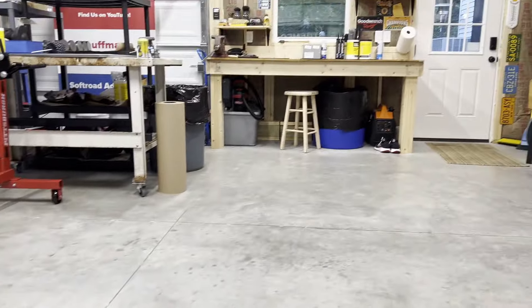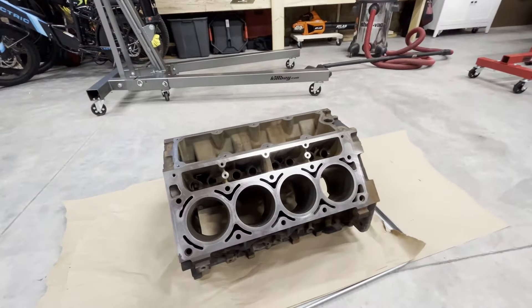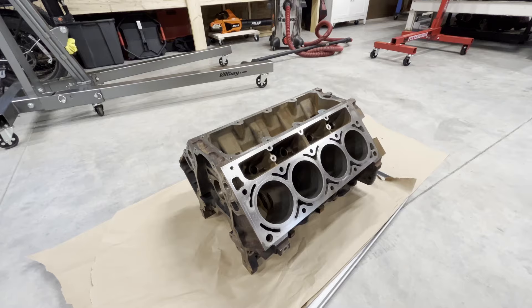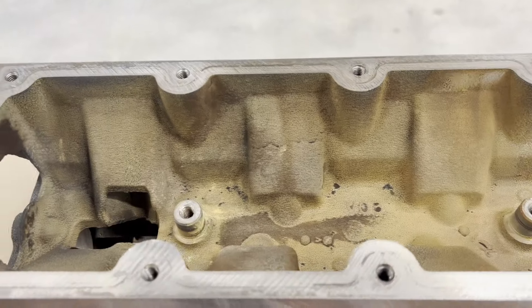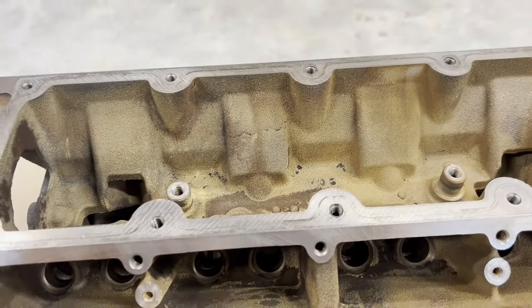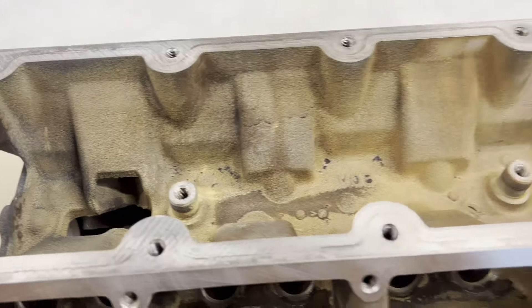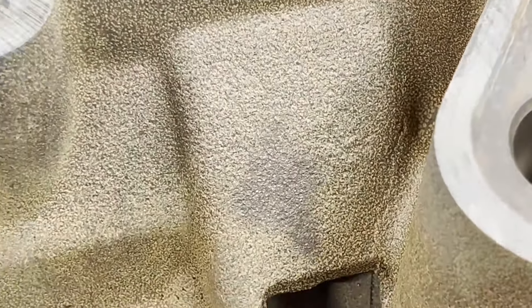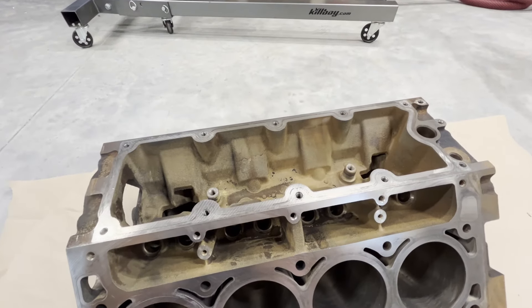I dumped this engine block in this barrel. It soaked for about six days if you've been following my videos. I soaked it using a product called Oil Eater. It came out super clean — I pressure washed it. What was my mistake in pressure washing? Well, that mistake was rust. I didn't dry it fast enough. I have some rust, but it's not anything major. You're really just seeing the color. I hit this spot right here with some brake cleaner tonight and it seemed to knock most of it off. I have to wash this whole thing anyway, so will all of this just wash away? I don't know — I'll find out. But that's part of the learning process.